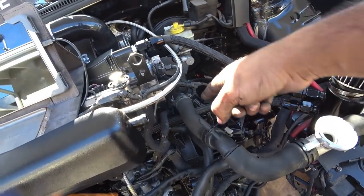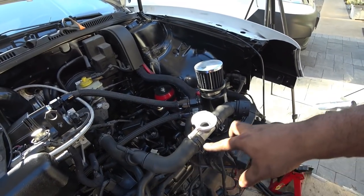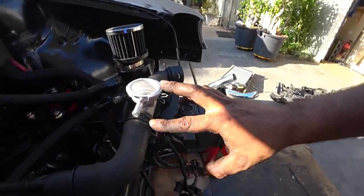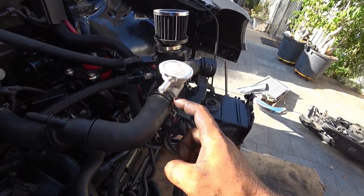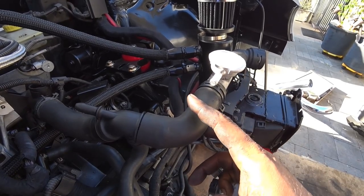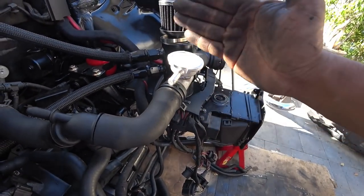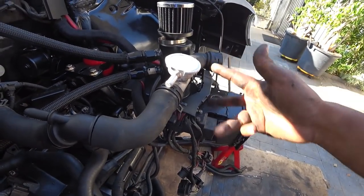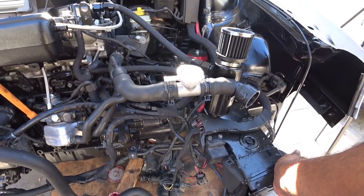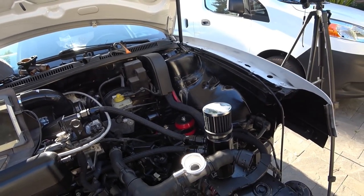Right here is a Moroso filler neck — this is a 1-1/4 inch neck. My hoses are a lot shorter than normal. The way it works: on the original coolant line it snakes over, but what I ended up doing was flipping them. I cut it in half and flipped them — put the smaller ends on this side and the bigger ends on the other side. The inner diameter of the hose is one inch, but the outer ends are an inch and a quarter. You cut them, flip in reverse, and cut accordingly to fit length. You could also just go to a parts store and buy inch-and-a-quarter radiator hose and fit it however you want.